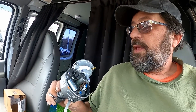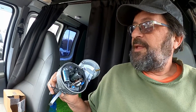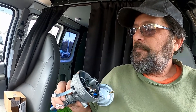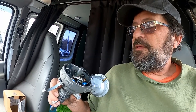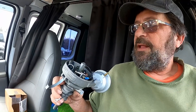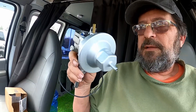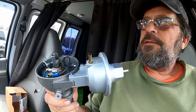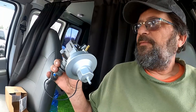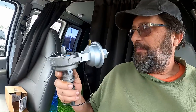That's certainly worth looking at. If not, I'll see what I can find. I might just take one of these remanufactured ones and find distributor shaft bushings and replace them myself. The Napa guy couldn't find a listing for them, so I might have to make my own. The vacuum diaphragm on mine is blown out too, so I'm going to have to buy one of these remanufactured ones and redo the bushings myself to bring them into spec.